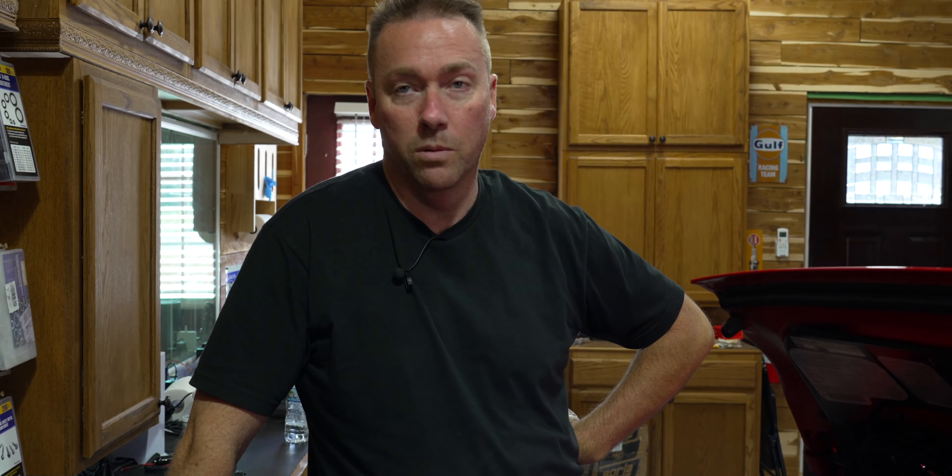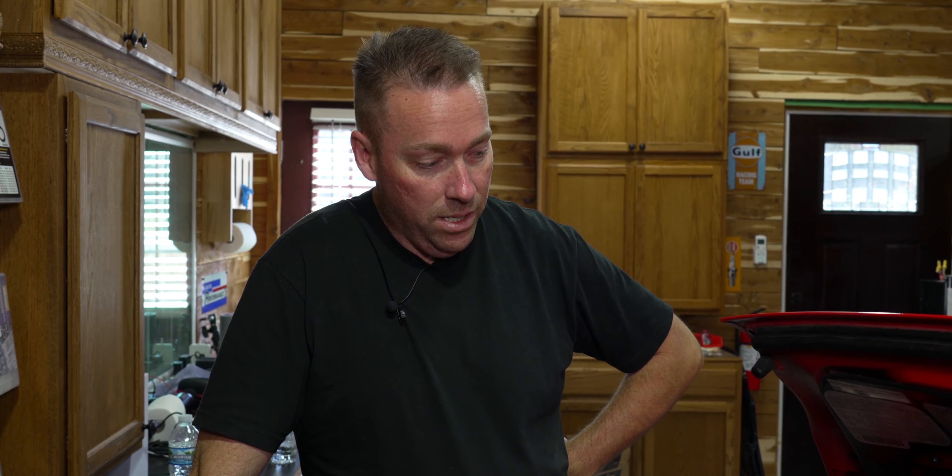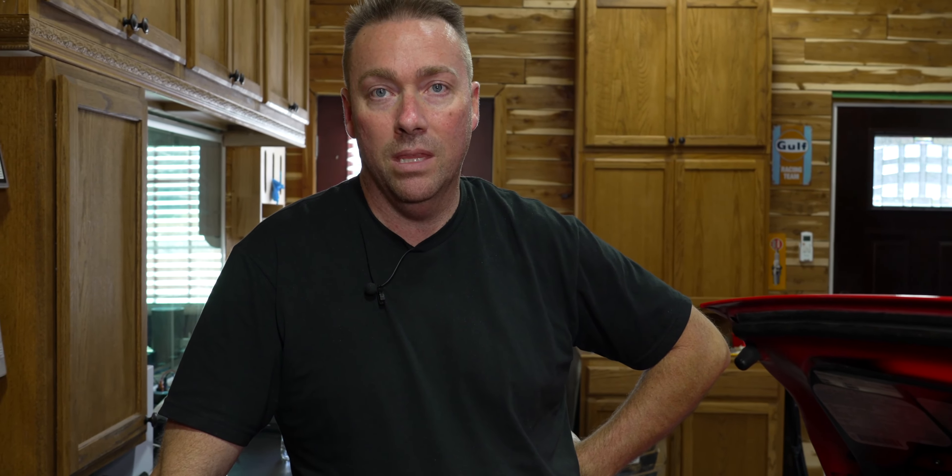Oh God, look at this. This is the water pump down here - look at this. Dealership, what are you doing? Let's start it and verify that was the noise. That's bad. I'm trying to remember how this car was set up. This is power steering - I was thinking that was it, not the water pump in the bottom. Power steering pump is new - maybe they were trying to fix that noise and just guessed wrong, or that was at an earlier date.